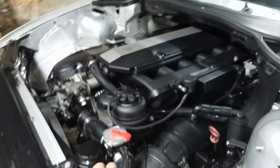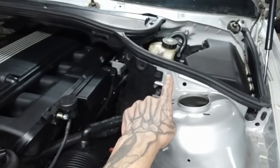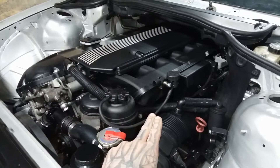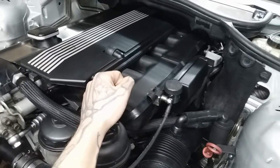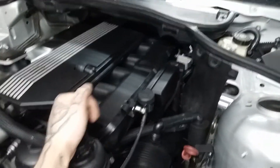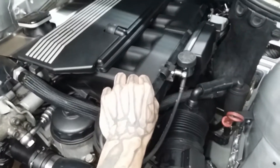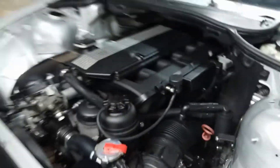Something new is the re-engineered power steering overflow setup. The reservoir was originally up here, but I put it down here because I wanted less distance for fluid to travel. It is now mounted to the intake manifold with the OEM fastener. You may or may not recognize it's from a certain part on the intake manifold, but basically it simply snaps onto the intake manifold — there are little ledges on it. I need to paint it satin black so it looks good, but it just snaps on there, out of the way, at the proper height so it won't hit the hood.